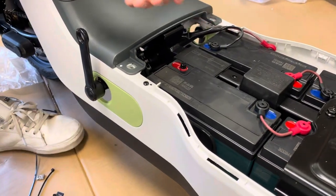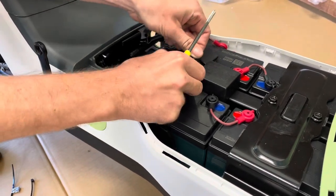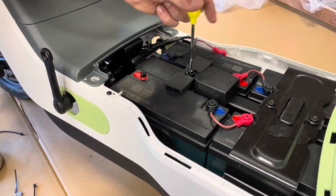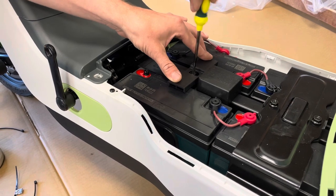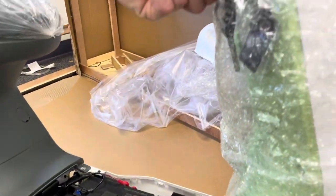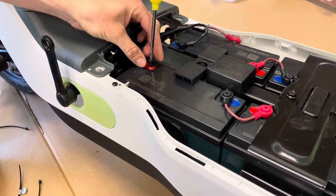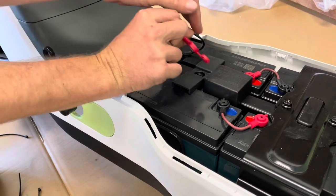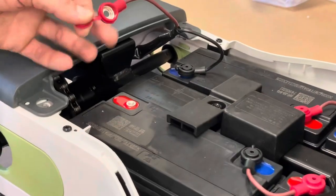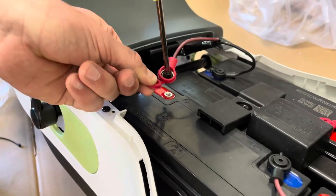Unscrew that, find the new piece, put it right in there and line it up with the hole — it'll just drop right in. Screw it in and make sure it's pretty tight so there's not too much motion in the battery. Make sure the bike is off first — it's pretty common that it'll be on. Disconnect the point on the battery that doesn't have a terminal connected, hold on to that screw, find the loose red terminal, put the screw in there, and then push it into place — note it will spark.